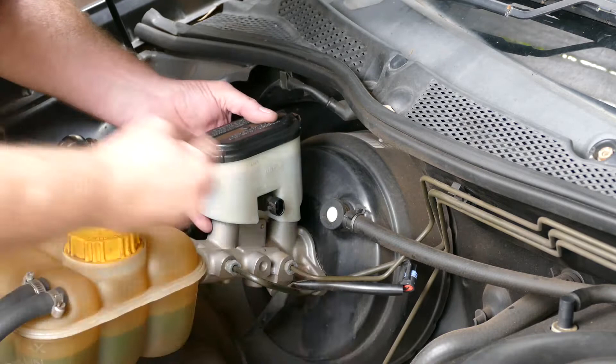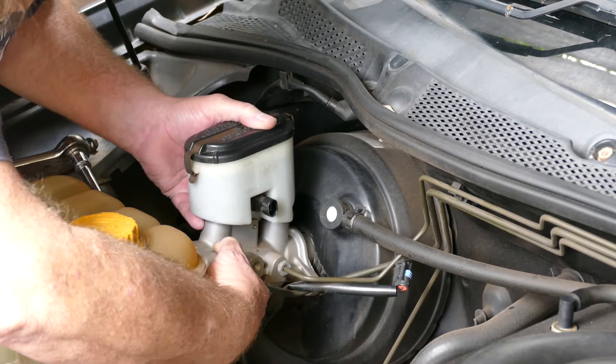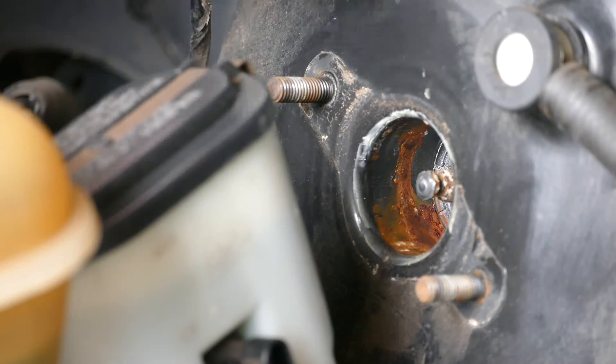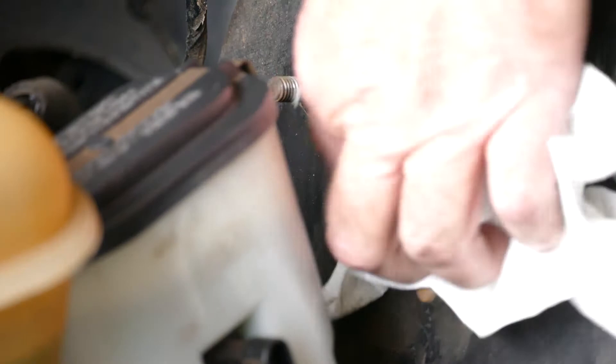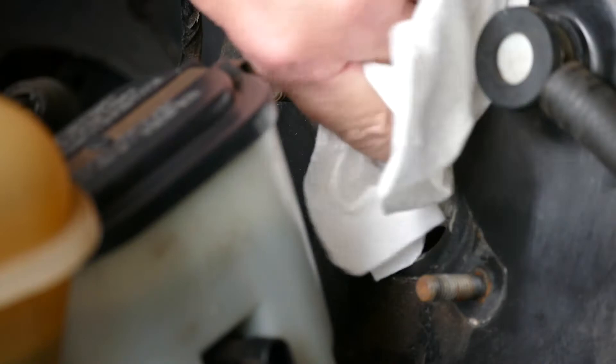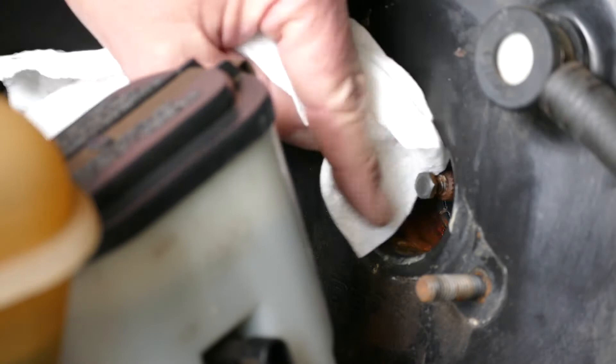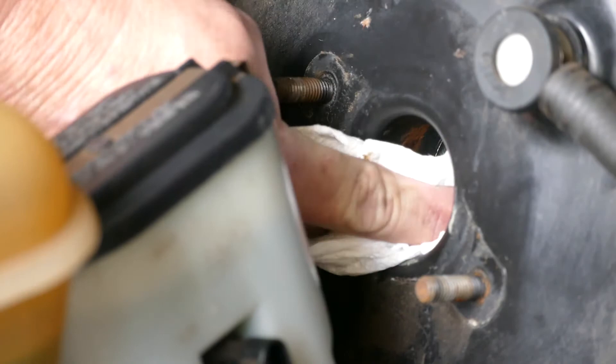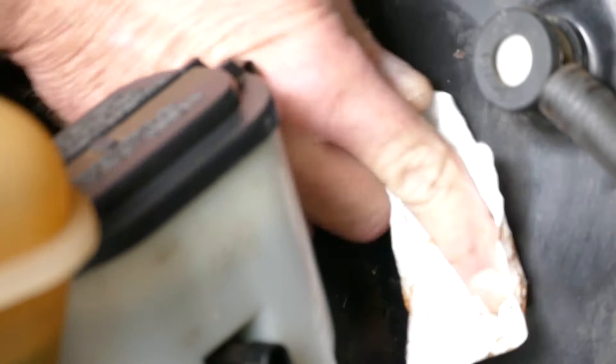While supporting the master cylinder with a wire, gently pull it forward and find the best place that you can. You might also want to gently clean inside the master cylinder where the pushrod goes using a cotton bud on a stick moistened with methylated spirits only, to get rid of any crud inside. Might as well clean around there too.